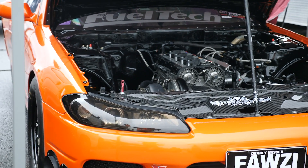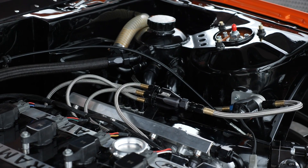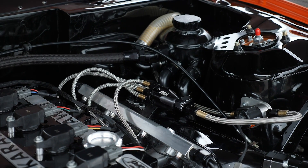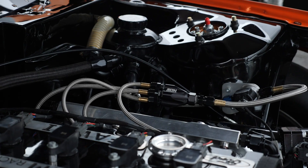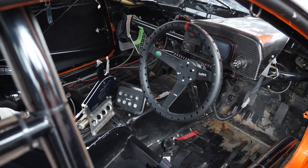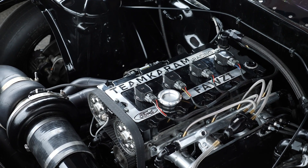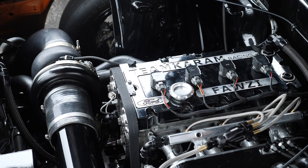One problem is getting the car to come up on the converter on the trans brake, which can be difficult with a small capacity turbo engine. You mentioned nitrous — how is that working? The converter in it is a little on the sloppier side. But we do run a dump valve, so once you lock the trans brake and bring the car into stage, you can bump or bring the stall up, and then the nitrous comes in once it sees enough TPS. That opens the dump valves, slips the converter, and brings the nitrous in. Once the RPM starts to pull over 6, 7, 8000, it'll naturally pull and make boost — it becomes self-fulfilling and exponential.